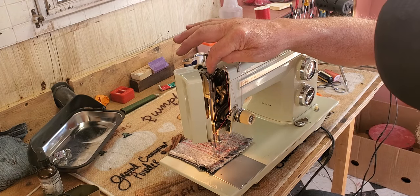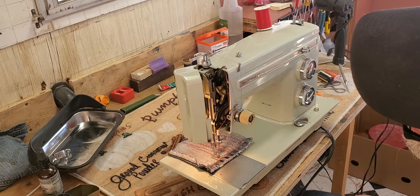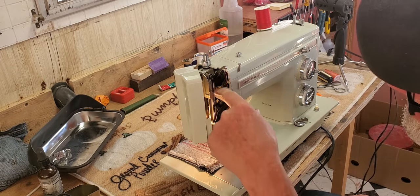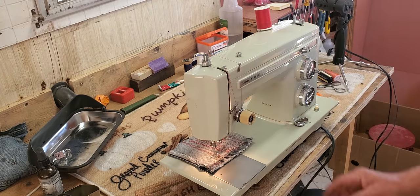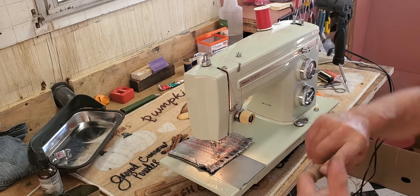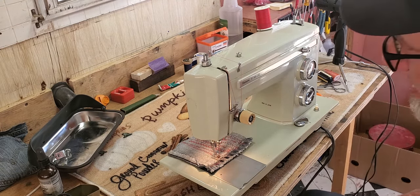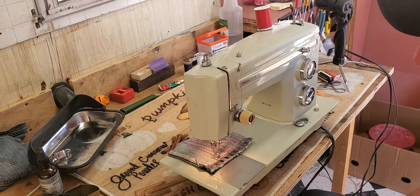For most of them, there's an oil hole or a spot on the, in the case of the needle bar, a drop of oil at the top and bottom there. Basically, everywhere that parts turn and rotate and slide against each other, you want a drop of sewing machine oil. Don't use 3-in-1 oil or WD-40. Use a good quality sewing machine oil, and that'll make your machine last a whole lot longer.